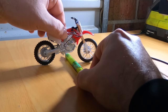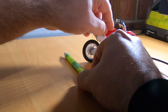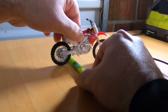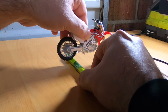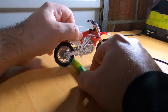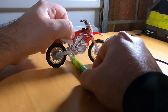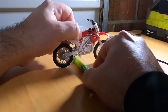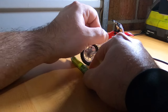If the spring is really, really soft, then the person will ride along and the spring will compress all the way, so the rider wouldn't feel much of the bump. If the spring was medium, then the spring will come up a little bit, it will take some of the force, but once it gets to a certain force it will start actually pushing the bike up as well. If the upward force is more than what the spring can take within a given movement — like a steel rod with no spring that can take 10,000N — and you hit a 20N bump, it'll jolt the bike up. But if the spring can move the full distance of the bump and stay under the force threshold, you won't feel the bump.